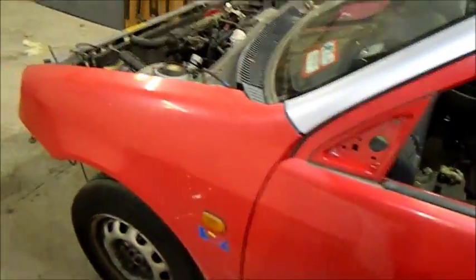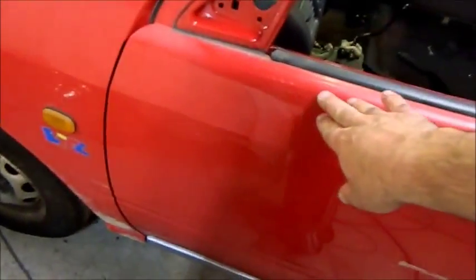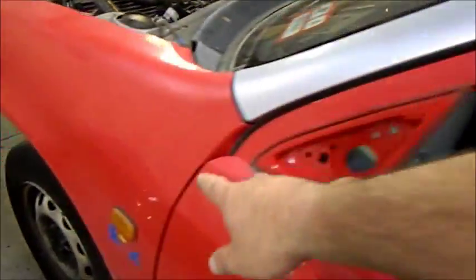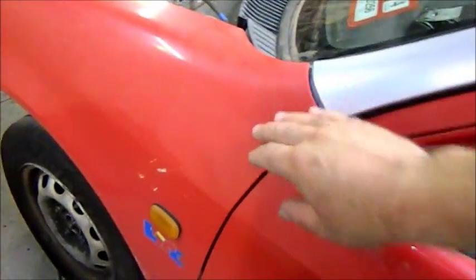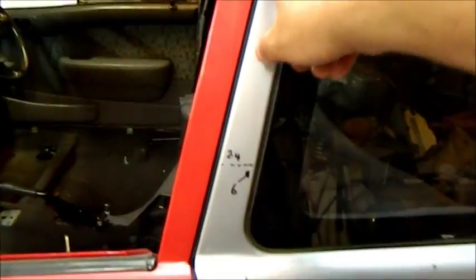As far as this little car is concerned, I've been using panels off the other car. I had to take the other guard off to put this door on. I wanted to change this door because the other one was so badly damaged. And that way, by setting up all these gaps around it, and I put the other guard on after, I can see when I set this one up, and I'm going to cut it roughly in that area there, but I can see that that's perfect, and I can fit up the other rear quarter accordingly off that gap there, and also off the tailgate gap.